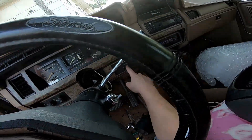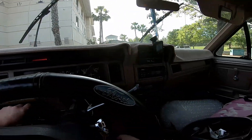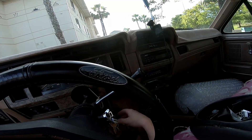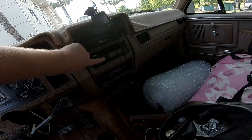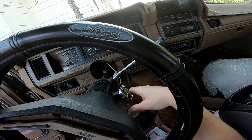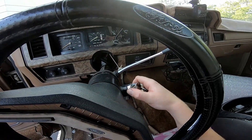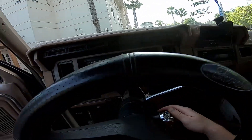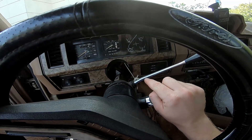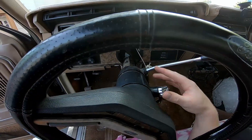Now the first thing I'm going to look for is my glow plug light to come on and my radio not to flicker. My glow plug light is on, the wipers are on. My radio is still not coming on — oh, there it is. Just start it up and see what happens. Alright cool, we're up and running. I'm testing out the accessory mode and it doesn't seem to be working, so I'm going to make some adjustments by loosening those two nuts and sliding it a little bit toward the front of the truck. Alright, I'm now in accessory mode and my radio is on — we're going to tighten that down.